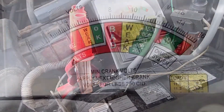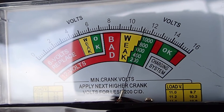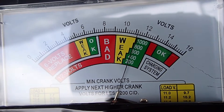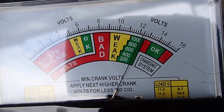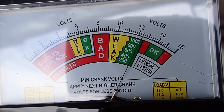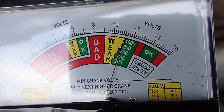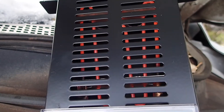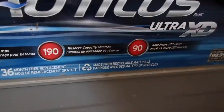The first thing I did was test the car battery. It's probably a couple years old, not super strong, but it still works fine. You can see it drops down to about 800 cold cranking amps and it's still in the green — so overall it's a good battery. I let off on the button and it bounces back above 12 volts, sitting about 12.5. You basically push the button to start the 100 amp load and hold it for 5 to 10 seconds while this thing heats up.